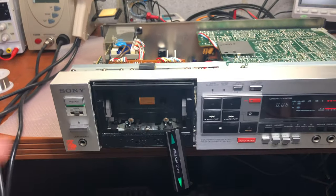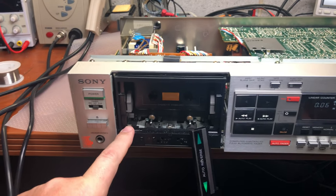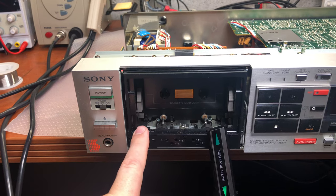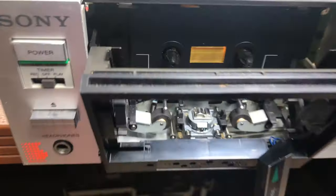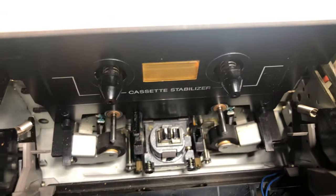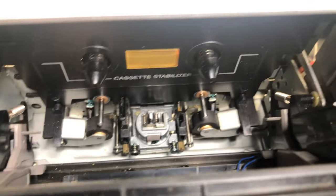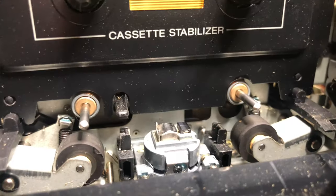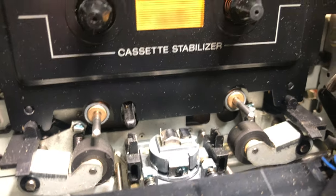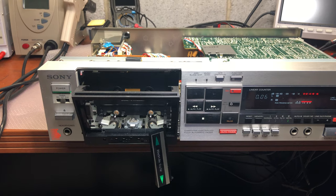I will need to disassemble — I'll need to remove the front plate to get access to the tape transport, and probably remove the top cover to make sure I have enough space and access. The pinch rollers I will try to refurbish; they look flat and nice but there is some deterioration. The heads look to be pretty good with minimal wear — no significant grooves yet. So I hope this deck will perform very nicely.